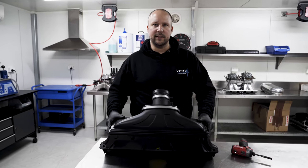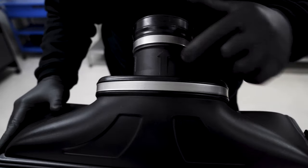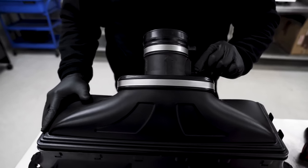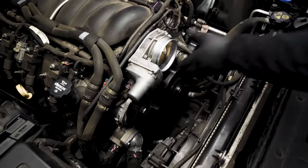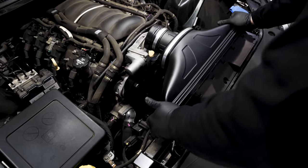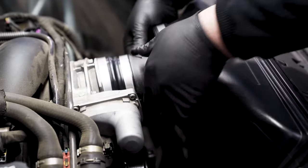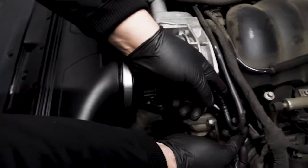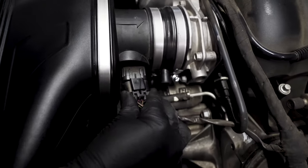That's the completed OTR build. You'll notice the arrow for the MAF direction is not quite in the center — that's to give you clearance for the MAF connector under your engine cover. Put the clamp over the throttle body itself and then install the OTR assembly. Tuck the MAF wiring just behind the purge valve line and then connect it.